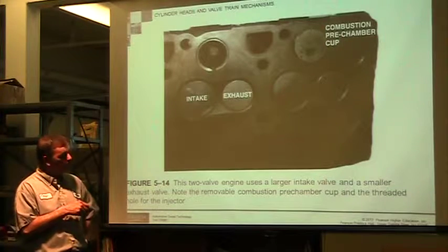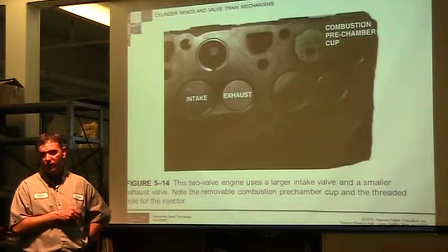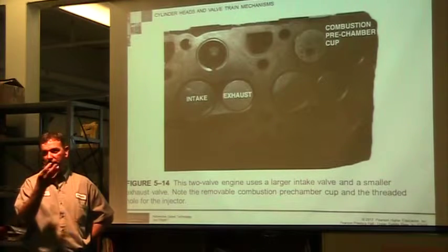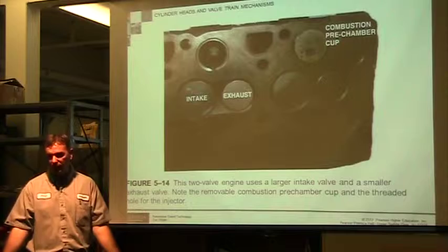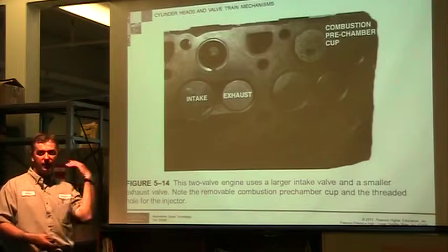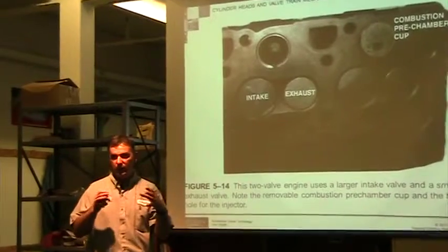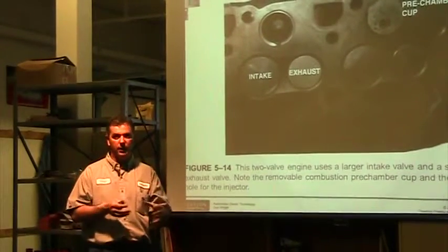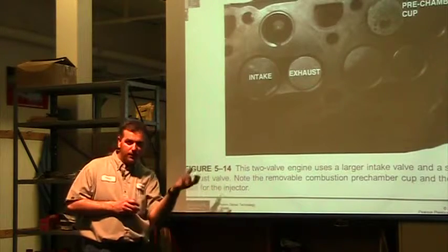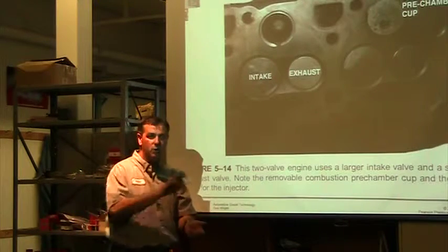And when we open up the engine, do we suck air into our intake? No. So just like in the gas class and the gas engines, atmospheric pressure is pushing in there. The piston traveling down creates a low pressure area, and air is pushed in by atmospheric pressure. And I want to emphasize that, because if my air filter is dirty, really, really dirty, not just dirty, if it's really dirty, atmospheric pressure can't push itself through it. And so we create this big negative pressure in the combustion chamber, and atmospheric pressure can't do its job to push it in.